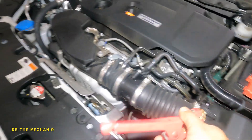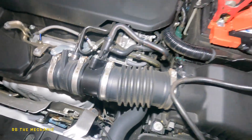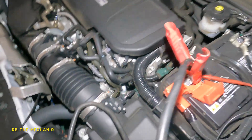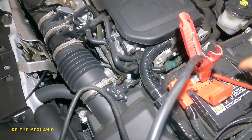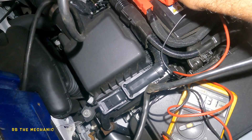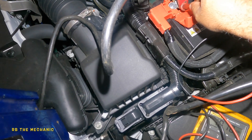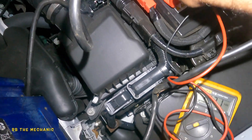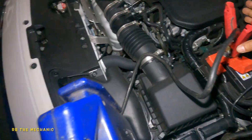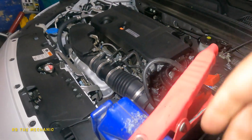I'm gonna show you that too. So we're gonna put this on the positive here, and I'm gonna put this on the negative. I gotta put my voltmeter on, then we're gonna check. Right now we should get better voltage. Go ahead, crank it. So as you can see it's giving 14 volts right now, but every once in a while it kicks off — it doesn't want to hold all the power. So we decided to get another alternator.